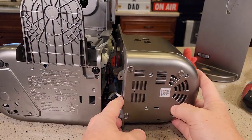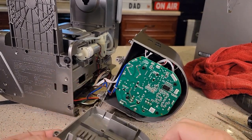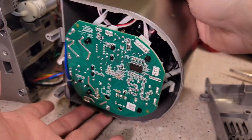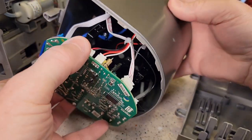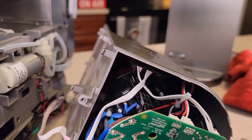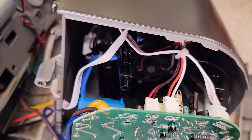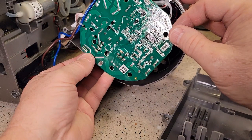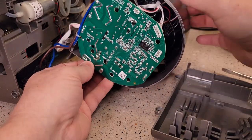I've really been anxious to see what the frother side looks like. It looks like a star screw — it takes a T10. When you take those screws out, the bottom comes off. The frother has a huge circuit card in it — there's a lot going on there with that frother. There are two Phillips screws here, but that doesn't get us very far; they really don't want you to get inside the frother. It looks like a great big coil that makes the spinner spin — that coil is what causes the magnetism to spin. There's really nothing you can do on this frother side. If your frother does stop, it's probably this circuit card — and it could be that maybe some water gets down here somehow. There's really nothing meant to be worked on on the frother; I don't see a reset.